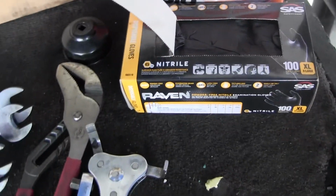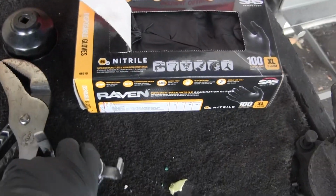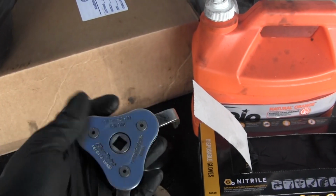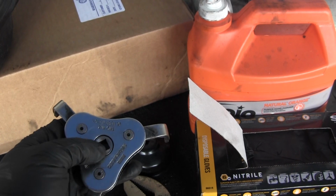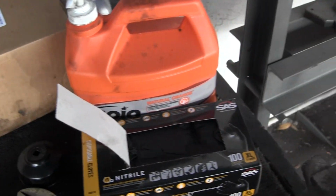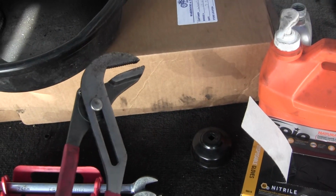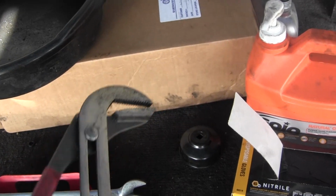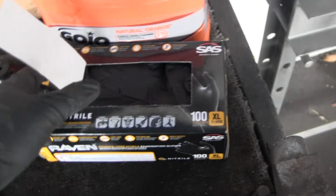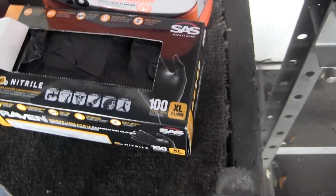But sometimes people will put them on with a wrench, put them on too tight. So then you need a wrench like that, or a claw type like this, where as you tighten this up, the claws tighten around the filter, lock it up, and you can spin it free. If it's accessible enough, you can even use a pair of big channel locks like this. Just crush it, turn it. There you go.